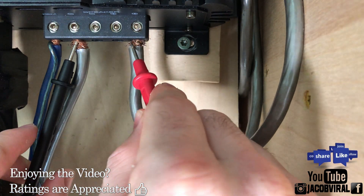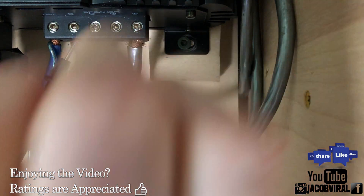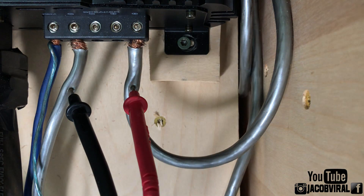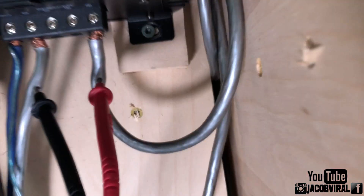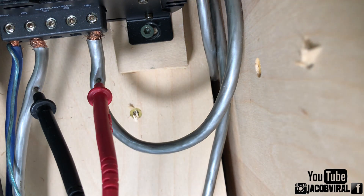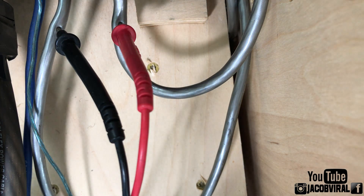I'm just going to put some speaker wire into my inputs — you can always just poke it into the speaker wire if you have little probes, it'll connect in. It shows 0.7, so it's around 0.5 to 0.6 ohm for my wired load. It's wired down to half ohm, but realistically with the subwoofer not being hot, just cool in the morning, it could be within a couple of decimals. I know it's under one ohm at least, confirmed by the multimeter ohm reading.